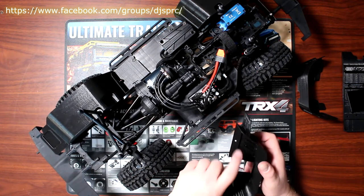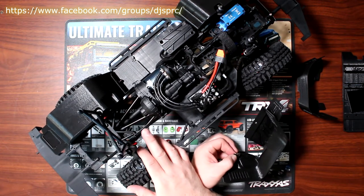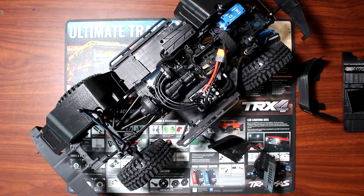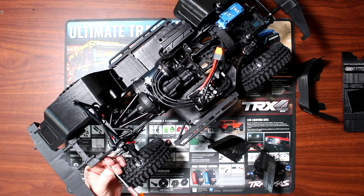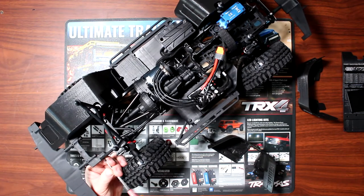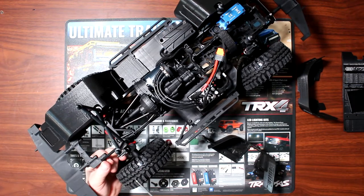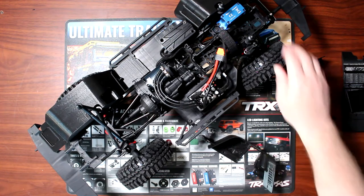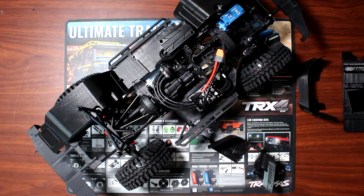You remove the bolt that holds your rear bumper mount and bolt the fender here. There's no existing bolt on the chassis at the second mount point, so I just grab a nut and bolt to secure it. Let's start by removing the rear screw that holds the back bumper. Even if you decide to upgrade your front bumper mount in the future, it will still work — my front is already upgraded to aluminum and the fender flare is still bolted to it.